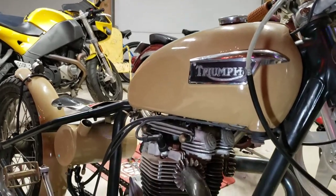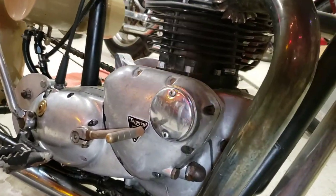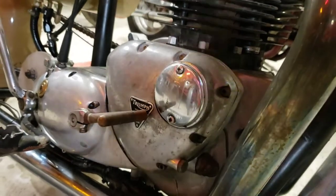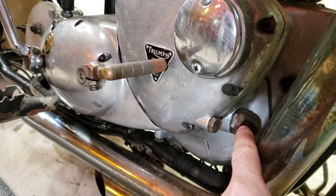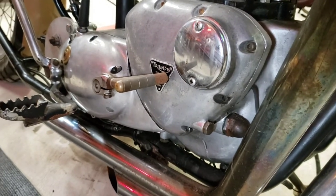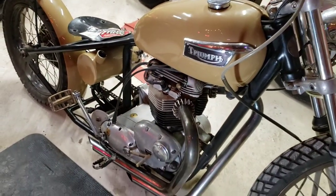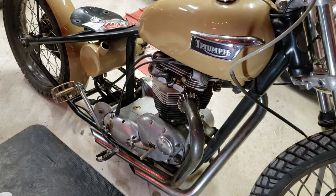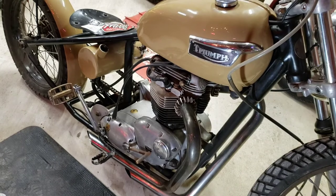Step 4 is going to be the oil pressure release valve. You can see it on my motor here — it's kind of like a double bolt, but it has a screen behind it. That is going to need to be removed. You're going to want to remove that, clean that screen properly, and put it back on. When putting it back on, make sure you tighten it very well — there is a lot of pressure that comes on that bolt, and it is a very common place to find leaks on these motorcycles. After you clean that, let's get to the oil.